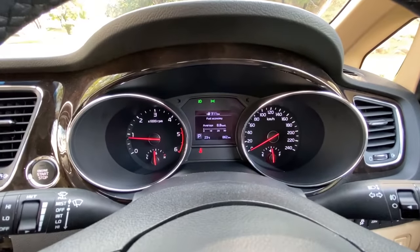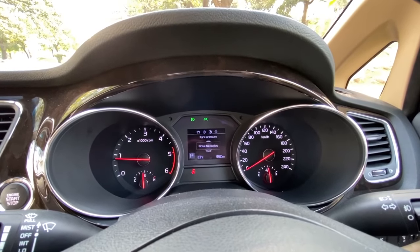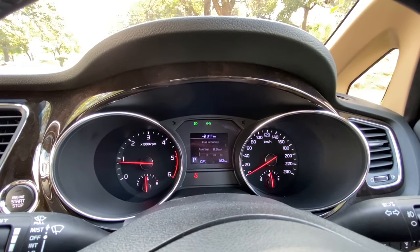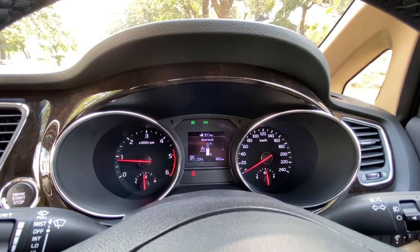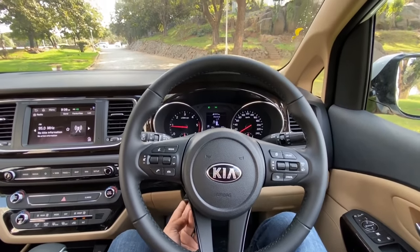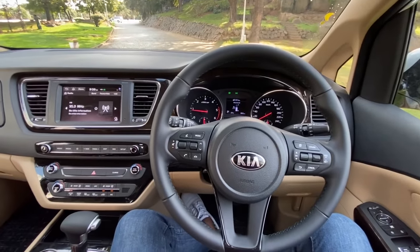The binnacle is very wide — traditional in style. On the left is a tachometer with temperature meter inset, on the right a speedometer with fuel meter inside, and in the center a multi-information display. The MID gives a compass, tyre pressure monitoring, and functions like door, light, sound, and convenience settings. Fuel economy currently reads 8.8 km/l. It also shows the urea level since the car uses selective catalytic reduction — a 14-litre AdBlue tank for BS6 compliance. The steering is adjustable for both reach and rake.